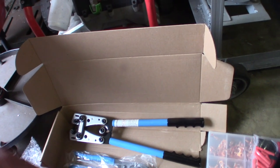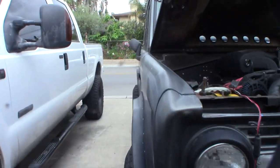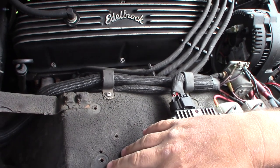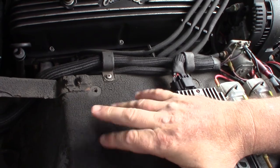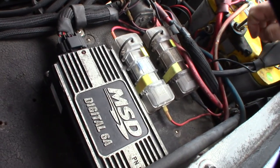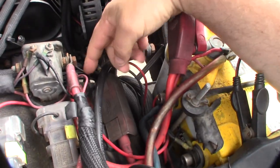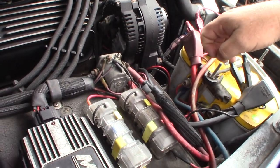I'm going to remove all the old fuses, weld all these holes shut, and then re-spray it with rubberized coating. I'll weld the holes shut after I take all this stuff off, let it dry, and then do the wiring tomorrow. Today I just want to do wire cleanup — look at this, there are three different heavy gauge wires on the solenoid here. A nice clean fuse panel is the goal.